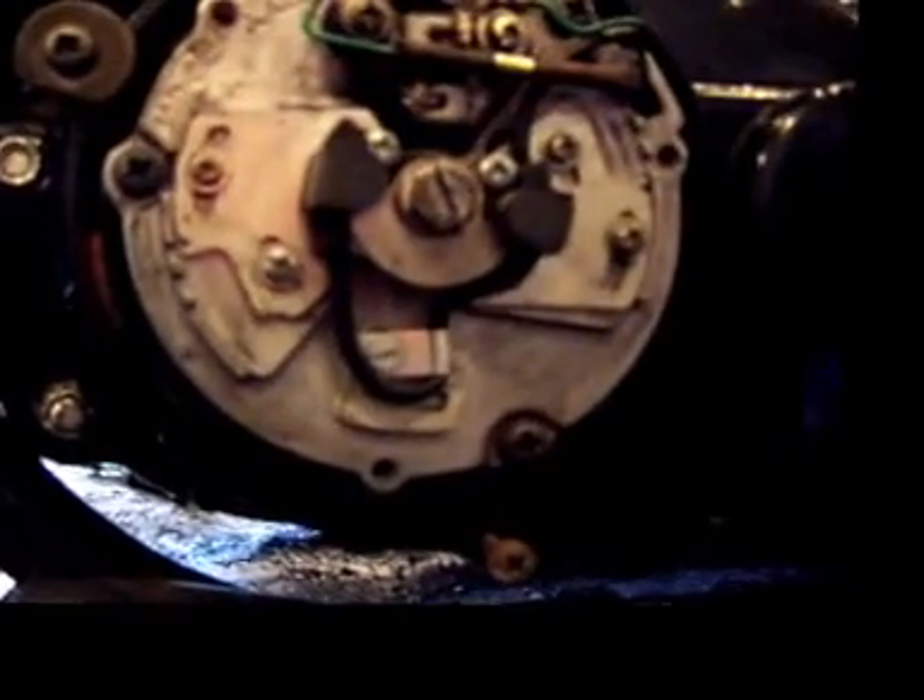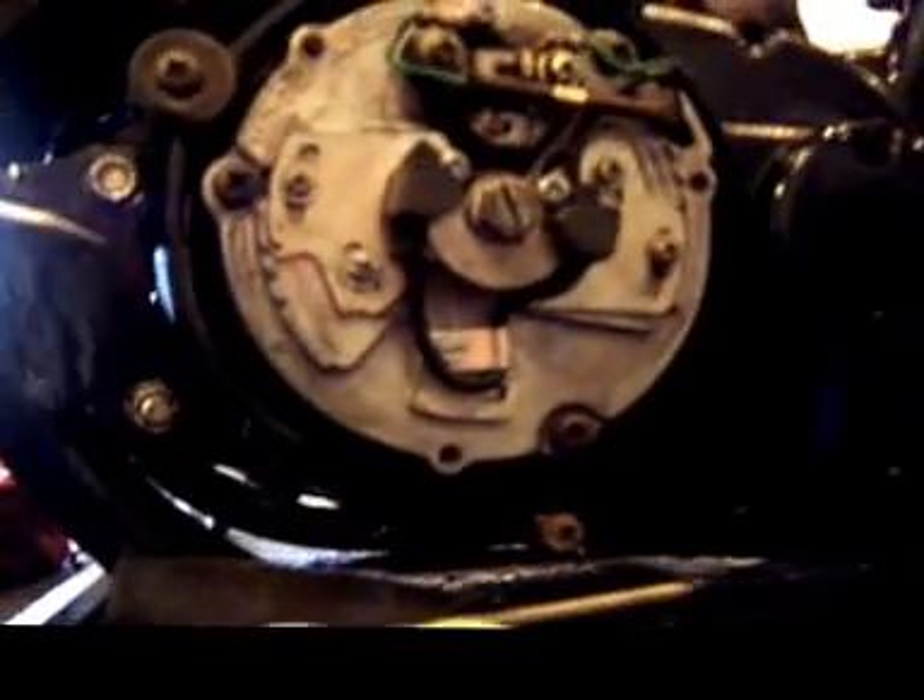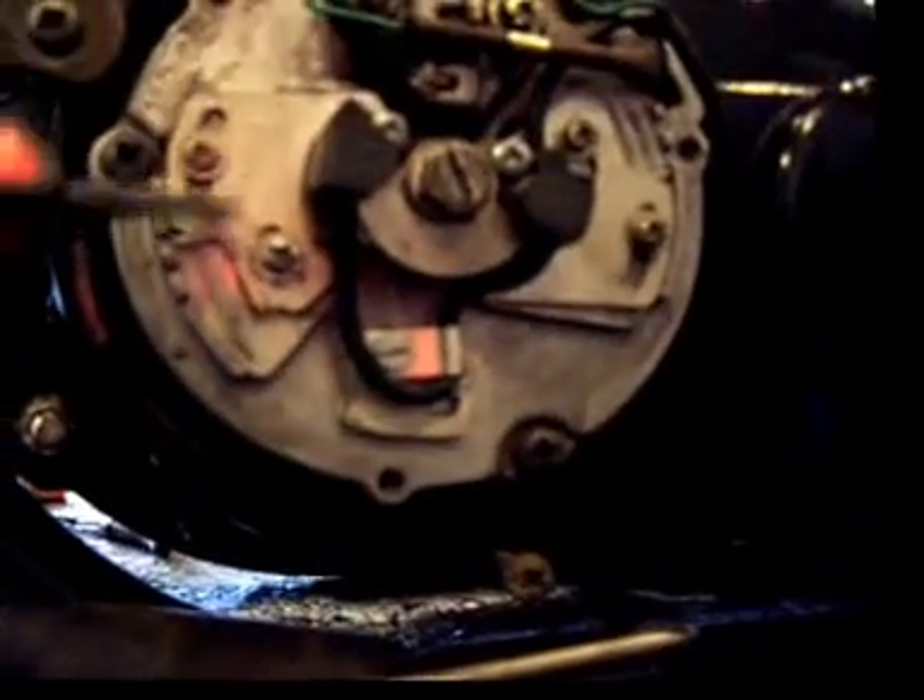The previous person had this motor set at about two and a half millimeters before top dead center, and sure enough when I got it the top end was shot — that may have been from the timing or from some other tuning. Our new position is about the middle of our travel, which is normally a good indicator you're close to where you need to be. Our timing reference puts us at the first notch.